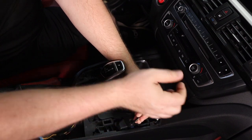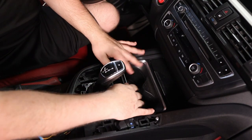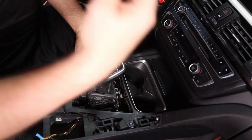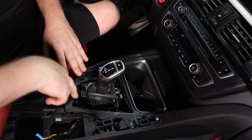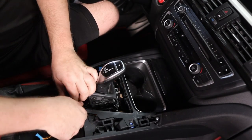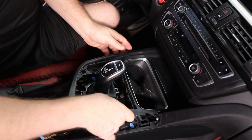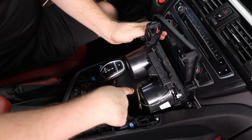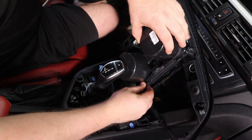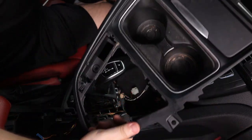The cup holder is a good spot to put those screws — remember don't throw the cup holder away before you get your screws back. Not all of these are the exact same — some have a little tray that pulls over the cup holders and people really like that. But I want the wireless charging and I don't need coin storage. To pull this out there's hooks in the back — four or so — and there's about six metal clips. Best place to start is back here in the back, that gives you leverage to lift up so those hooks in front will come out. Pull up — these are metal clips so they're pretty strong. There's a connector right here with two push pins — pull that out, then use the pick tool to get the back connector out, and the whole assembly is out.